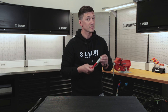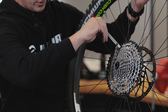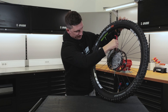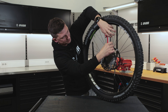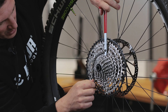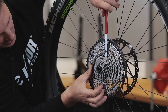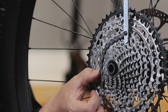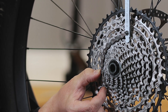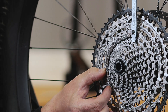How it works, I'm going to show you now. You place the tool on one of the cogs from the cassette, find the fitting, and then you apply a tension by a force of 10 kilos. What you need to check is the last chain pin. If this one fits in nice, that shows us that the cassette is okay.